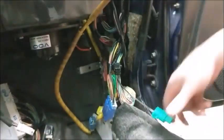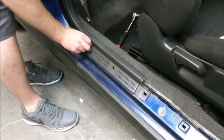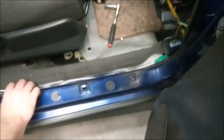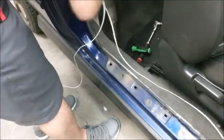Once the fuel pump controller is grounded, you will see a long white wire. It will run underneath the back seat on the passenger side. Take out the rear seat by undoing the two 12mm bolts on each side. Then take off the rear trim so you can run the wire underneath it. Run the white wire in the gap in between where the carpet clips into the panel so that it is tucked underneath and isn't pinched or smashed by anything.